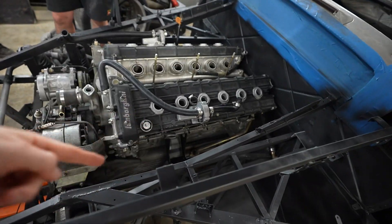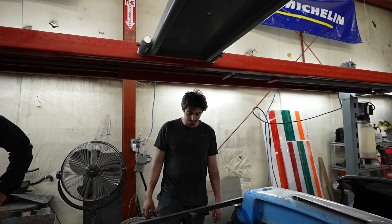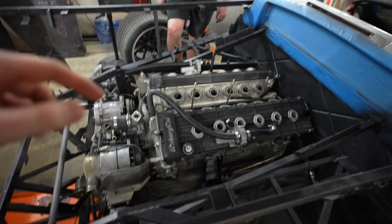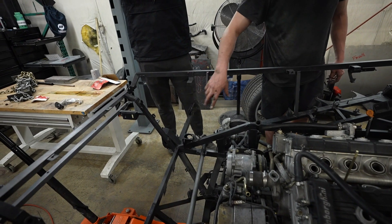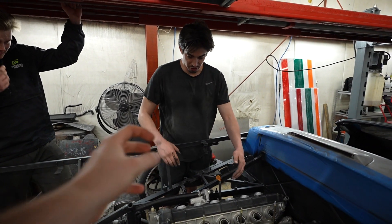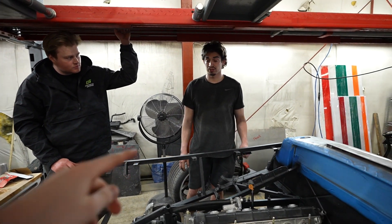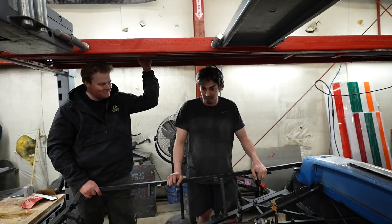We need to get the lego kits out and route all the piping — a lot of tubes for a lot of different purposes to fit in this engine bay. It's a generously sized bay, but when you're going up to two-inch tubes it'll be tight. The manifold and headers go straight into the hot end of the turbo — technically an up pipe since it goes up. We're doing air-to-water intercoolers, the encapsulated kind. The stock manifold is a two-piece, so we can add cores and utilize the stock setup.